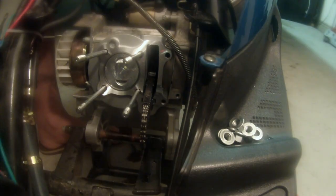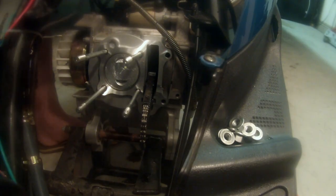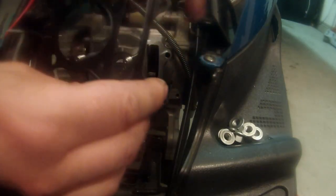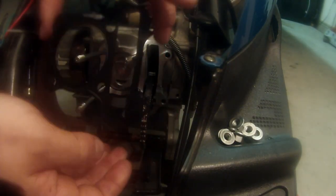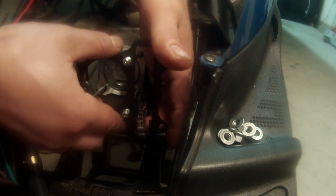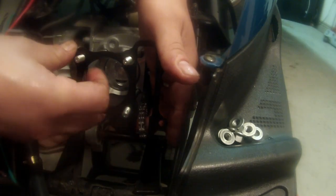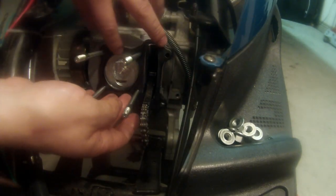Let's put our head on. So now when we put our head in, we want to work our gasket on there. The gasket is pretty easy to tell — this is the metal gasket that comes in your kit. The way you want it to go is you're going to have a big opening, and then a little tiny groove right there — that's going to go on this side. So we're going to go ahead and slide that on, pull our chain up through it, and take our time. This is the metal gasket that came with your kit — the one that we put in between the jug and the engine, that was just a typical gasket.